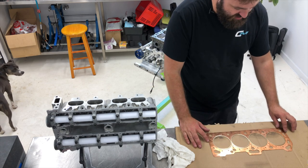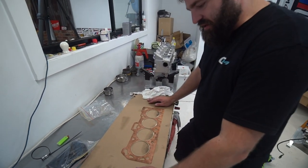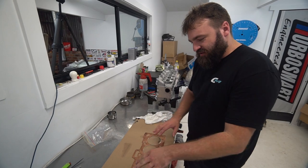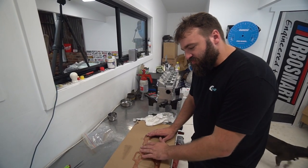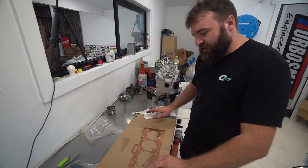There's a bit of prep work that goes into this. On the other side of this piece of cardboard you'll see a lot of this black goo, which is our 3-Bond that we use. It's like kindergarten finger paints. You've basically got to smear this glue on to a thin layer, and with your fingers is the best result I've found — until it's at a uniform thickness across the whole gasket.